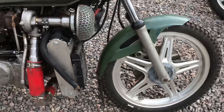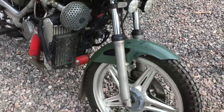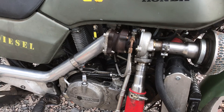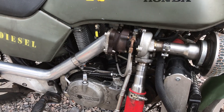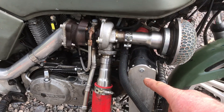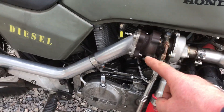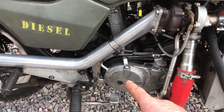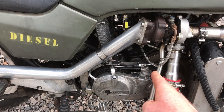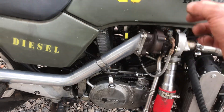This is the walkaround of the Super Dream Diesel. It's got a 500 twin Z482 Kubota engine — a 180-degree 500 twin with a little turbocharger on it. We've got an intercooler here and a cooling radiator for that. It has a six-speed gearbox, which is the original gearbox of the Super Dream bike. I sealed off the gearbox, removed the petrol engine, mated the diesel onto that, and we drive via a 30mm wide tooth belt. This is Mark 7.